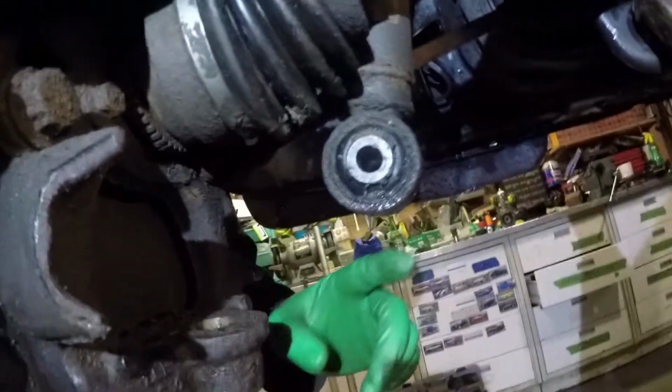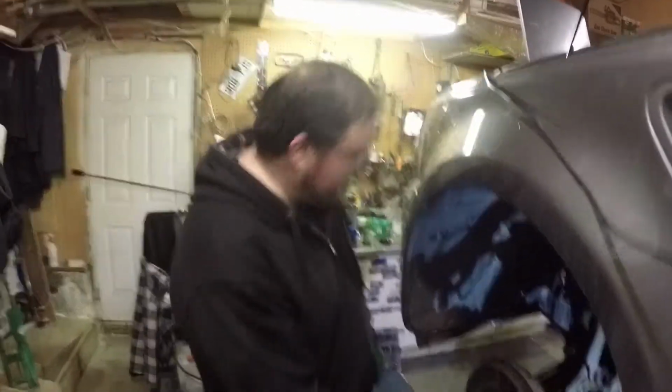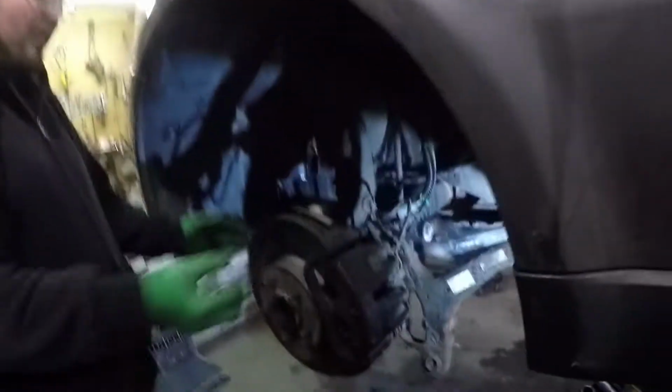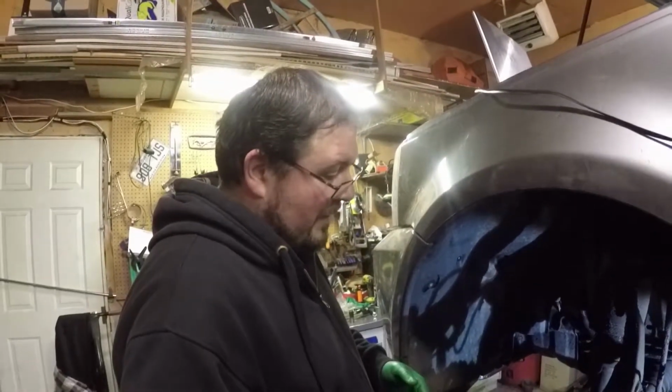So what we had to do, and also we're trying to find solutions for that back bushing, trying to work it, move it around some to try and break whatever rust is in there. So what we had to do is remove the axle nut at the back here. We just took the axle nut out with a holy shit bar. Needed all of this right here. Yeah, about a 4 foot bar. Yeah, this was probably 5. Torqued to PFT. Yeah. Pretty freaking tight. And then we could push out, remove the whole knuckle forward. We didn't even have to remove the tie rod, that stayed attached. So this entire knuckle swung up and to the front so that we could push the axle out. So that worked pretty well.